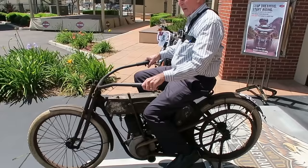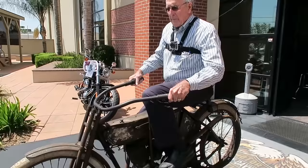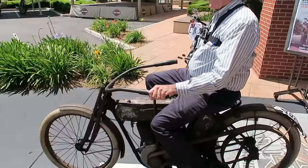Okay, we're ready to start it again outside. We turn the throttle off real hard, raises the exhaust valve, set the spark about halfway, tighten up the belt, start pedaling. Then we can turn the throttle on and press the brake, it starts right up every time. That again, like I said, is for the country, and it's for the city.